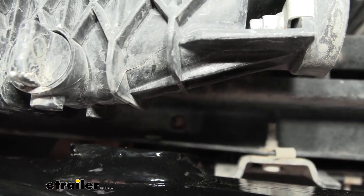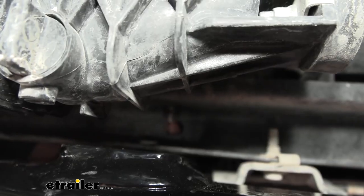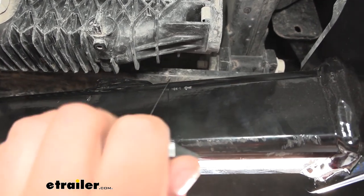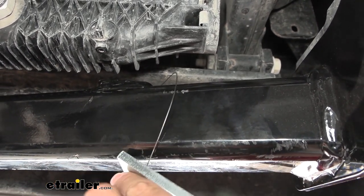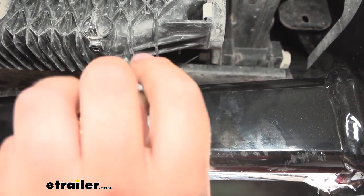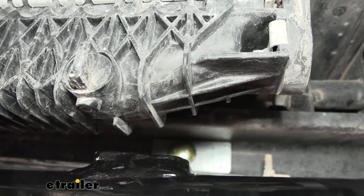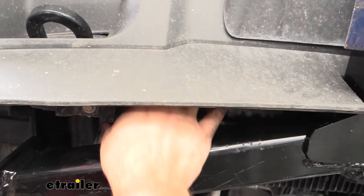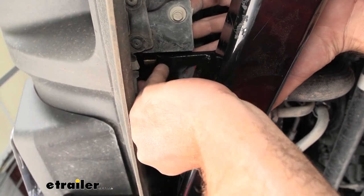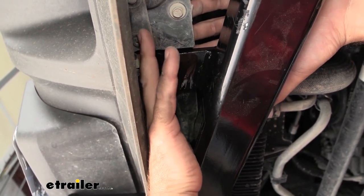Feed the coiled end of the fish wire through the front tab and through the factory hole on the radiator support. Once you get the coiled end through, feed the spacer block up and get the carriage bolt in place, then pull tension on the front. Once the bolt feeds through, grab your serrated flange nut and get it started while keeping tension by pushing on the head of the carriage bolt. Do the same thing on the other side — it's very tight so just take your time and be patient.